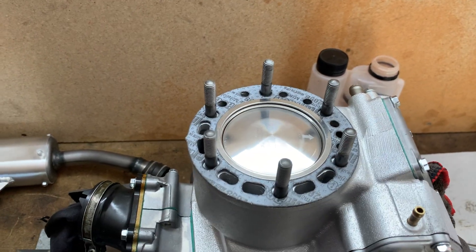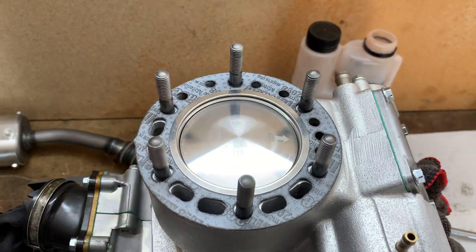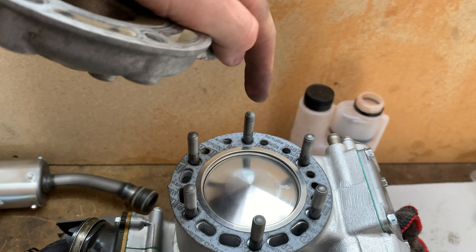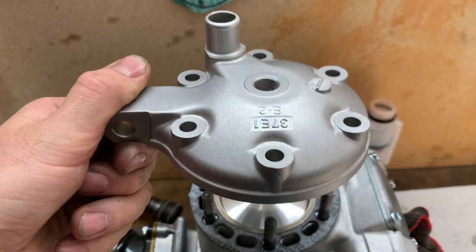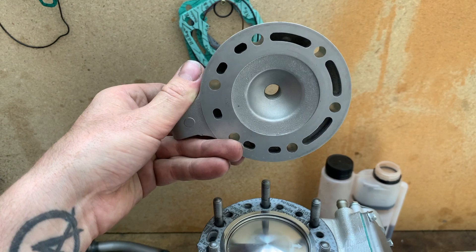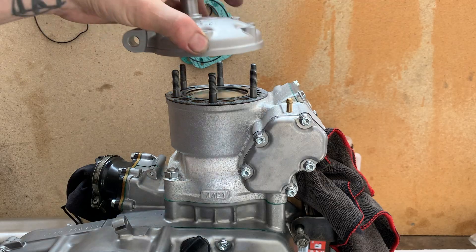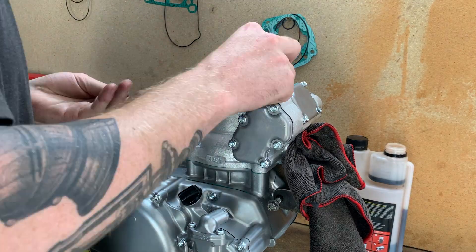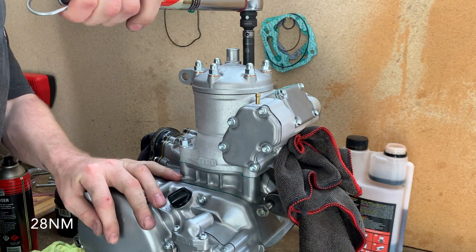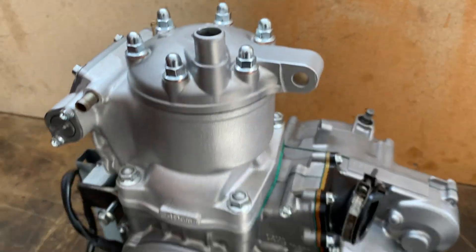When installing your head gasket you need to make sure that the little notch on the head gasket is pointing towards the inlet side and that the smaller holes are closer to where the water inlet is. Here's the RMX250 cylinder head — the water inlet is over here so the small holes need to be closest to that. I'm going to be using a 97 RM250 cylinder head and the holes are close to that as well so it should work fine. I've checked to make sure that the coolant jacket holes also line up with the head gasket and they do. The torque for the cylinder head nuts is 28 newton meters and with that this engine is fully complete.